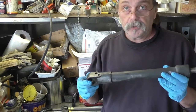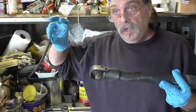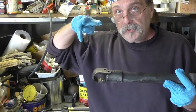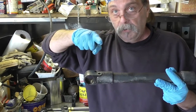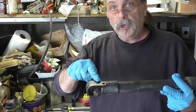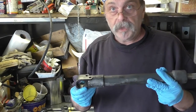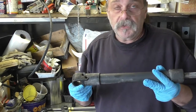And in case you forget when you take them off, on the back of the boat there's a distribution manifold, and there are 2 holes, one towards the bow of the boat and one towards the stern of the boat. And when you hook the cylinders up again, the front is to the bow and the rear is to the stern. Same with the hydraulic lines. So if you forget, it's real easy.